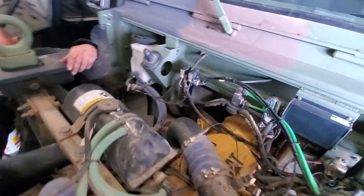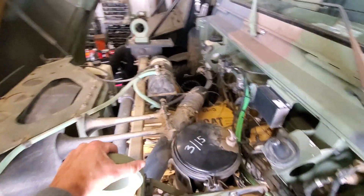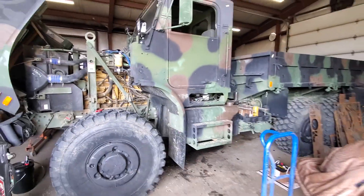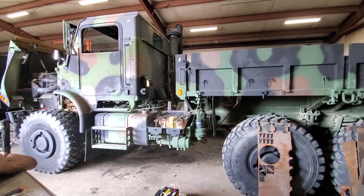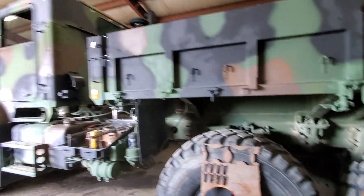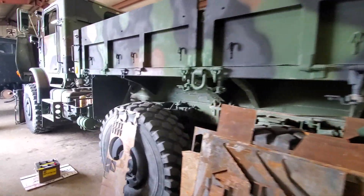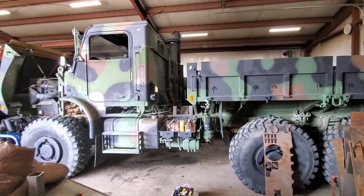That is the last one. So thank you Oshkosh for making what should be such an easy job, not easy — but at least it states everything you need to on a door placard, which is better than many manufacturers out there. Pay attention to that — those modules are not inexpensive and you could do a lot of damage by just doing a quick weld. We won't even tack weld on the truck. How these things are supposed to be EMP shielded yet are that susceptible to weld current is interesting, but it still makes me a little nervous.